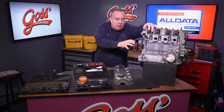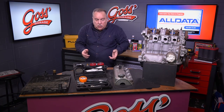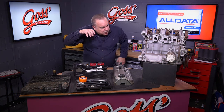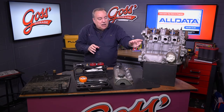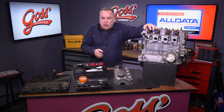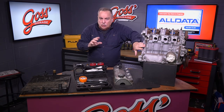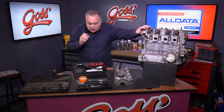Now we know we've got a major problem in the bottom of this engine. But suppose we don't really hear anything there. The next thing we do is go to the tailpipe of the car — get your ear down there, of course the engine isn't running — and see if you hear air coming out of the tailpipe. If you do, that means one or more of the exhaust valves are burned or damaged somehow and they're not making an airtight seal. We know we have a problem up in the cylinder head, which isn't nearly as major as a problem in the bottom of the engine. Down here, you usually replace the engine. Up here, you typically do a head gasket, valve job, or something like that — a lot less costly.